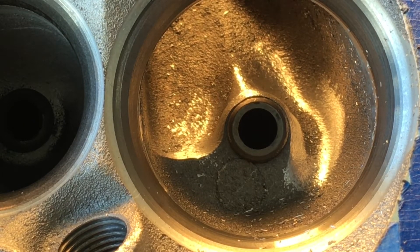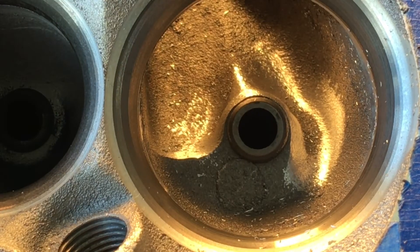When you're removing your swirl ramp on these cathedral port cylinder heads, you have to be super careful. Do not dig down too deep, because there is a coolant passage right below the swirl ramp on a cathedral port head. You will be able to create landmarks while you're working your port that will help you avoid digging too deep or cutting out too much material.